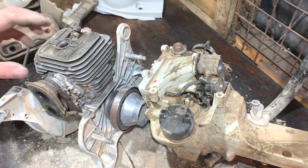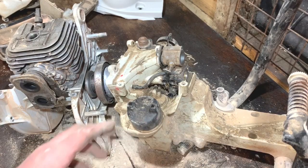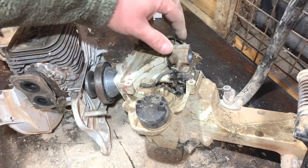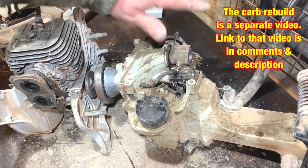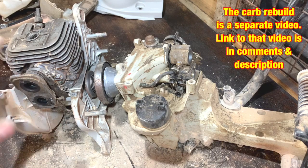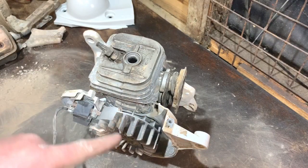I've been battling with this a little bit, but now I've managed to separate the engine from the fuel tank, the handle and everything. I'm not sure whether it's the right way to do it or not, but it seems to have worked and I can get to where I need to get to. All of this has got to be cleaned up. The carburettor is on there — I will take that off, clean it out and give it a new diaphragm and gasket. But at the moment, looking in from the carburettor port, it's just as good on the carburettor side. I'm really pleased with that — both sides of the piston are good.